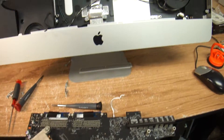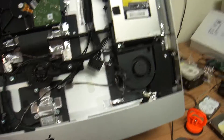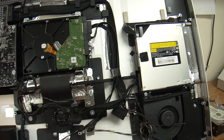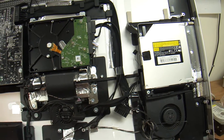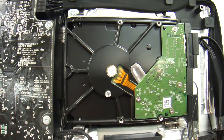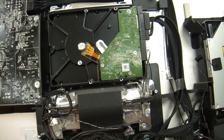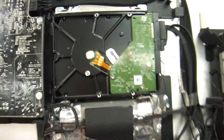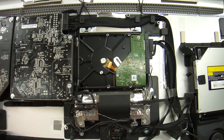When I was modifying my Mac, I basically used the CD-ROM slot to lose the CD-ROM and add a drive. I did not know that there was actually a connector for another SATA drive. So what can be done is this large desktop hard drive can be removed, another cable can be added, and you can have two laptop hard drives placed in here with a custom bracket — and you would have a CD-ROM and two hard drives inside of an iMac.